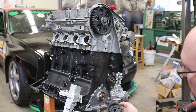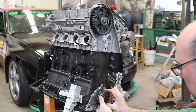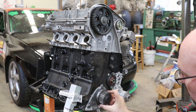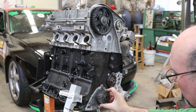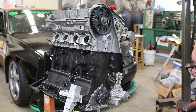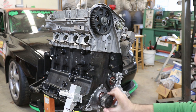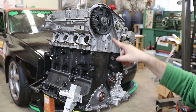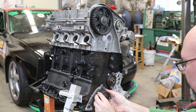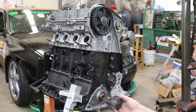The crankshaft gear is pretty self-explanatory. There's a little notch on it which lines up with the keyway. There's no timing mark on this gear that I've been able to see, but I do have cylinder number one at TDC — there are two holes in this gear and the keyway is pointed straight up in line with the cylinder bores. That's how you know this is TDC. When you put the gear on, the notch should be upward.